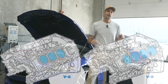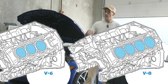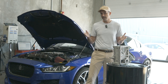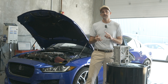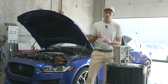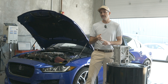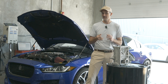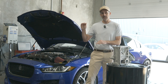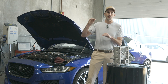The V6 engine fundamentally is the same as the V8 — the rear two bores on the block are just not punched out. It has a shorter blower fitted to it, but dimensionally it's the same. It runs the same fuel system — the same low pressure, high pressure fuel pumps — and it also runs the same ECU. So to V8 swap any of the V6 equipped JLR engines is a relatively straightforward thing to do, and you combine that with the fact that there are V8 versions of them.